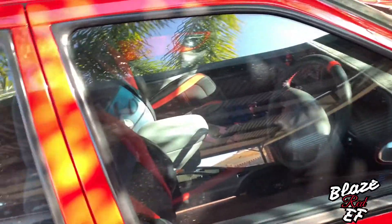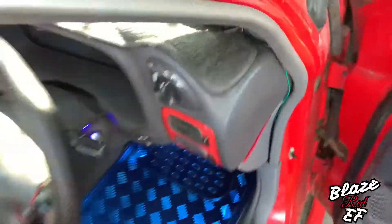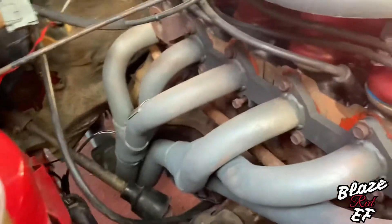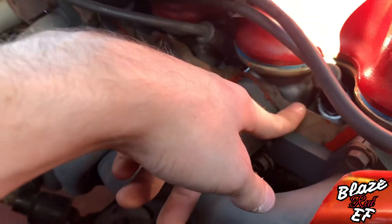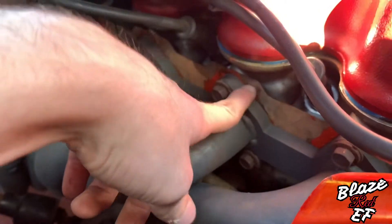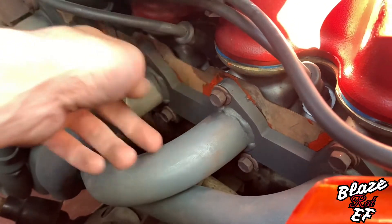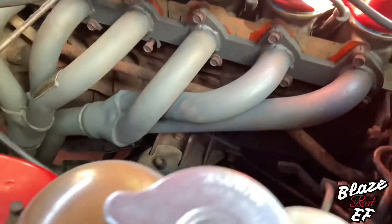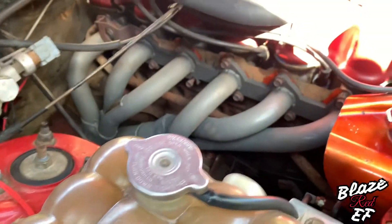I've also put my extractors in. I'll just open up the bonnet for you — yeah, there's the extractors in there, also with the high flow cat down the bottom. I've got a bit of an exhaust leak because the exhaust gasket that I bought didn't actually fit, even though it said it was suit EF Falcons. I've got another one on its way, and I'll be doing a video on how to pull off your main headers and replace the gasket. There's a special bolt pattern you've got to undo and tighten back up, otherwise it doesn't line up properly. I'm also going to be getting some new bolts because I couldn't quite get the bottom one back in and didn't want to crack the head.